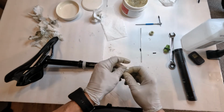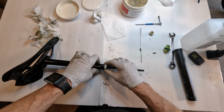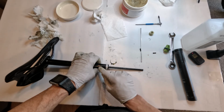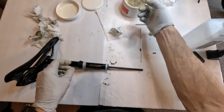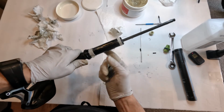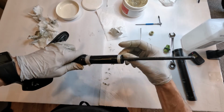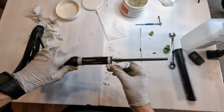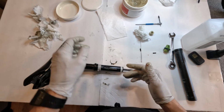So now, this guy over here, split ring. Okay, try and align the actual ring with the pin, right? So now let's put some grease on the outside. Liberal with it. Don't be afraid, grease your friend. Again, first few rides it's going to make a bit of a mess, but it's okay. Nothing a towel can't take care of. Okay, so now we are all greased up.